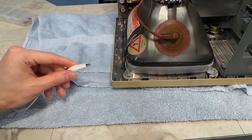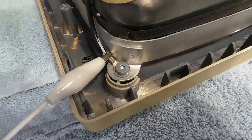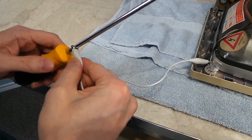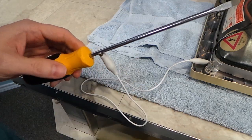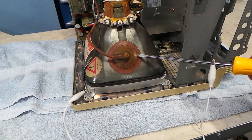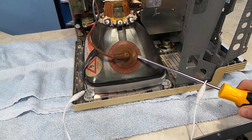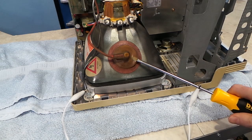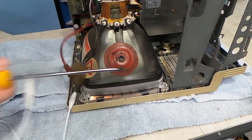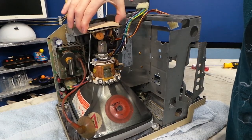So we want to discharge the CRT before going any further. Just attach an alligator clip to the ground lug of the CRT, then attach the other end to a long flat-tip screwdriver. Then insert the screwdriver under the rubber suction cup and touch the metal clips — if it sparks, you know you've discharged it. In my case it didn't spark, so the bleeder resistor had already done its job. Eventually you pop the suction cup off and lift the little board right off the back — it connects exactly like an old vacuum tube.